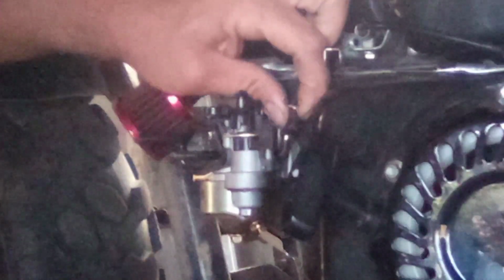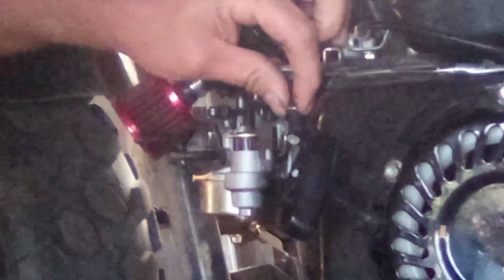Another thing you can do is if you got these needle nose pliers, come in here like this, get to the bottom of the fuel line, and then just kind of go around the metal part and use that to push it off. Alright. There we go.